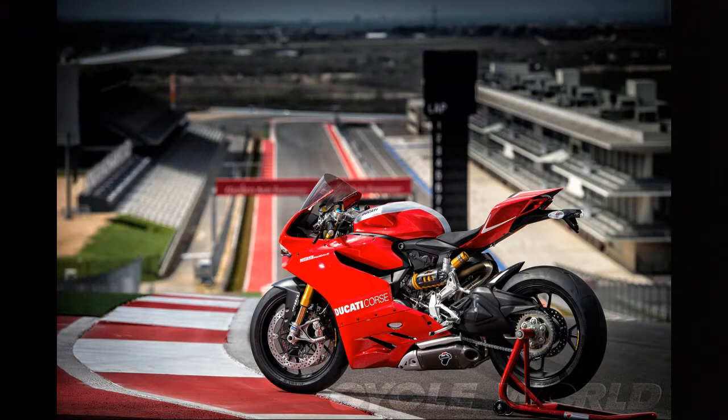The HP4 is probably unique in that regard. Quite a few bikes have dynamic steering damping, which I think is a very important and useful thing to have if you're going to have damping. You don't want to have fixed damping unless you turn it down so low that it's only of marginal utility. To get full utility, you do need to have some kind of active or at least semi-active damping, ABS, that kind of thing.